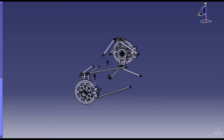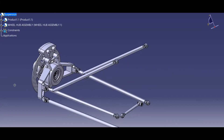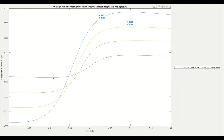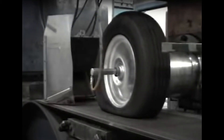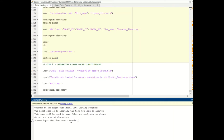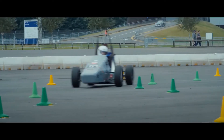We've designed a suspension system inspired by Formula 1 cars, in particular one that could be adjusted at the track based on the conditions on the day. We also needed to find out the forces exerted onto the tire during competition, so we built a solver in MATLAB to tell us just that. We took tire test data from a non-profit organization called the Tire Test Consortium, and used a tire model to find the lateral forces on the tire, giving us some very valuable insight into the performance of the vehicle in competition.